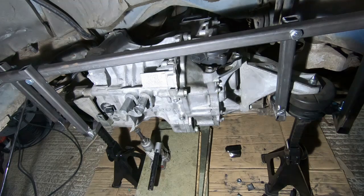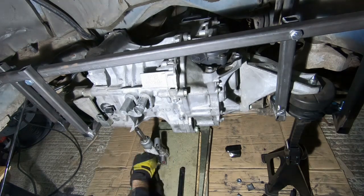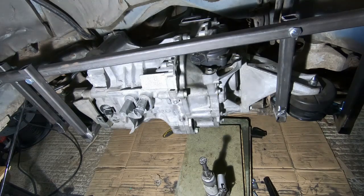We've got the top rail propped in place. Still needs to be welded onto the shim and mounting plates that I've made for it, but I'm going to try to see if we're heading in the right direction. So I'm going to lift up the engine slightly, then drop the axle stands and see if it stays supported or if it starts to fall down. So here we go. That engine is now totally suspended on our custom engine mount. There was a little bit of fore and aft movement, but that's to be expected because I haven't actually bolted the Leaf motor mount to my bracket at the front of the engine — it's just resting on the cross piece that I've put in place.